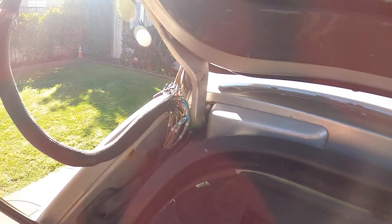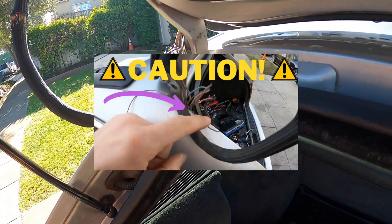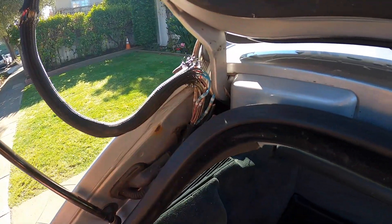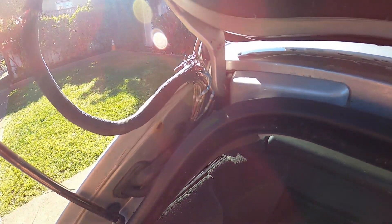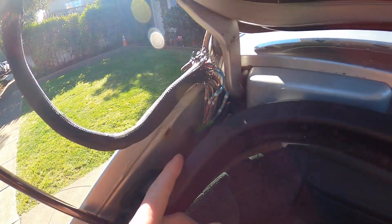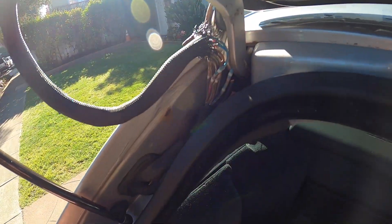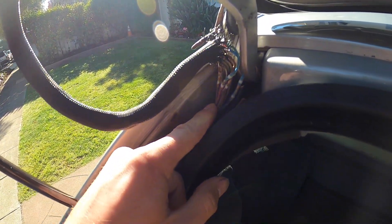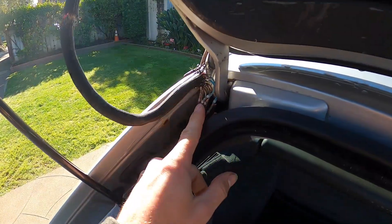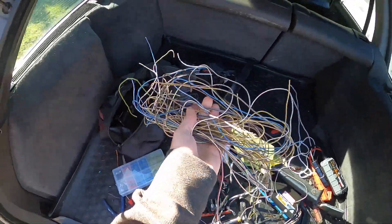I want to talk about why you need to shorten the wires over here by one to two inches. The reason you can't just solder the wires back together in the same spot where it broke is that the wire ripped in half at that spot — so if you crimp or solder it back together there, it's just going to break again. The trick is to shorten the wires by one to two inches so that the repair bends on the new replacement wire you ran, not at the crimp joint. It should last another 10 to 20 years.